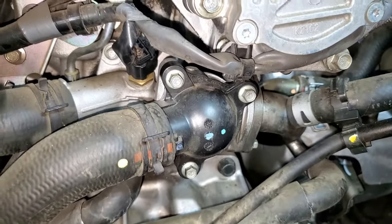The thermostat is holding itself in place, so we're going to go ahead and install the housing. You might have noticed that we did not have a gasket between the cover and the housing itself — that's because the thermostat itself has a rubber gasket on it, which creates the seal between the housing and the cover. Once we get these bolts tied in, we're going to torque them. The torque requirements are anywhere from 71 to 97 inch-pounds, so we're going to aim for about 90 inch-pounds.